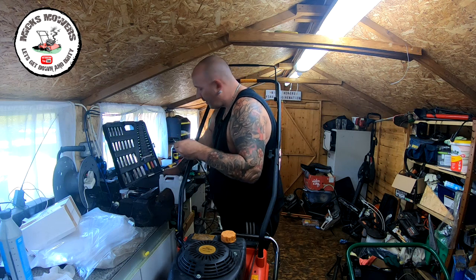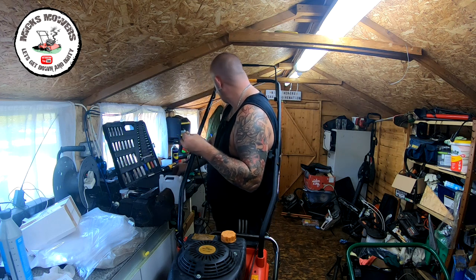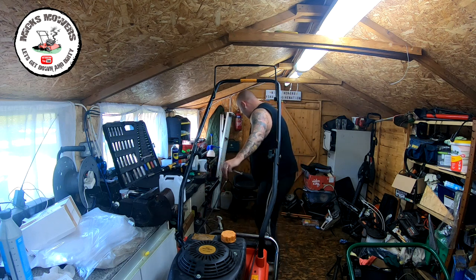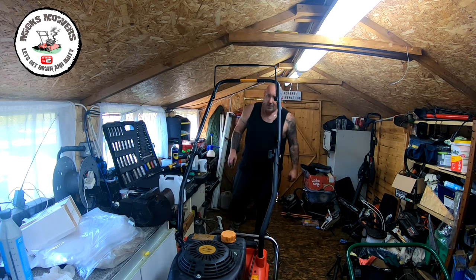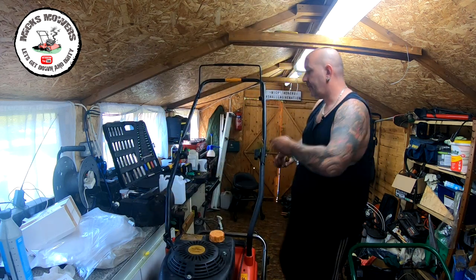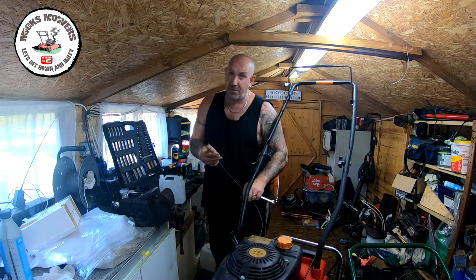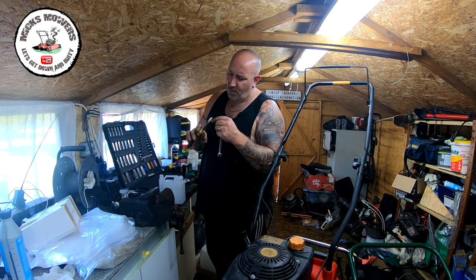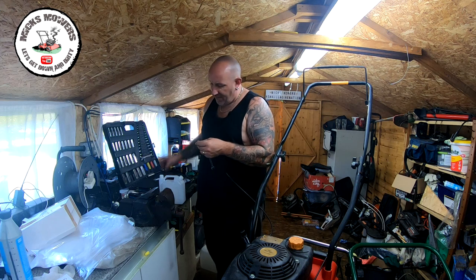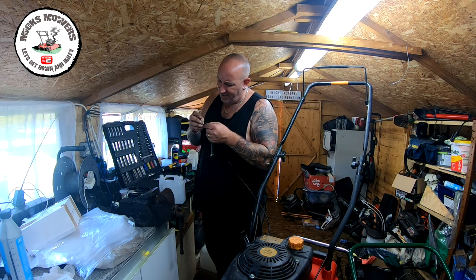And all we're going to do is get my cable crimp, put it on, go down about 20 mil. It's going to be about there. I need my snippers, maybe they're down here. So I want my snippers. And I want to take 20 mil off of this cable. So let's take 20 mil off. It's going to be about there. And then get my cable crimper. Put that on. Put my new dead man's handle in. The dog leg end. And about there. Yeah, it's going to be about there. It'll be about right.